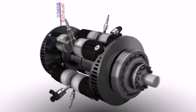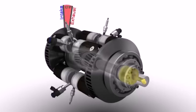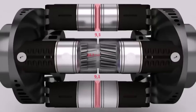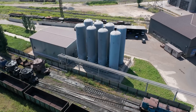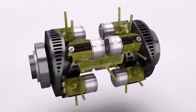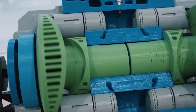The positions of each plate can also be adjusted. This makes each of the opposed pistons move slightly out of sync with each other, so they don't perfectly meet in the middle. This causes the fuel to be squeezed together less, and therefore less compressed. Different fuels like to be compressed by different amounts. Therefore, In-Engine says the E-Rex could be optimised to run on whatever fuel you give it, making it ready for more sustainable fuel options like hydrogen. The issue with the wavy swash plate is that it requires rollers, and these could be a failure point during repeated use.